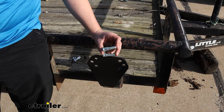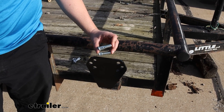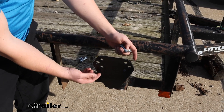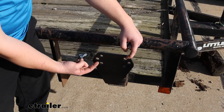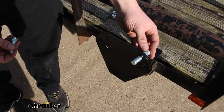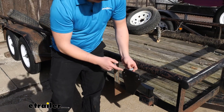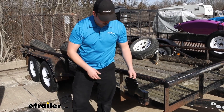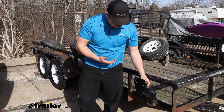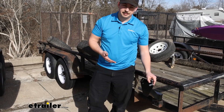In your kit to mount the spare tire, you're going to have two different bolts — one larger and one smaller. That correlates with different holes on the face of the spare tire carrier. The top corner and two bottom holes are the larger holes for the larger bolt. The two other holes and the one up top are where the smaller hardware comes into play. Depending on the bolt pattern of your spare tire, you'll use different holes, so make sure you use the right ones — get your tire up into place and you'll see what you need.